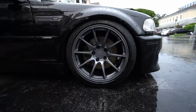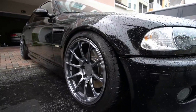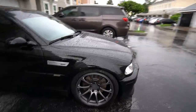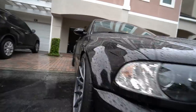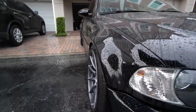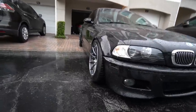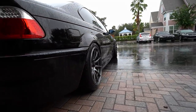Looking at the front, it's a pretty tight fit up here as well but there was more camber that needed to be adjusted. Up front I believe we're sitting at negative 3.5 degrees, which is pretty good for handling — a lot of people who take their E46 M3 to the track run negative 4 to negative 4.5. But this is more of a daily than a pure track car, so I'm looking to maybe straighten the wheels a little bit in the front if there won't be interference at the top. As you can see it's a very tight squeeze, and you want a little clearance so when you're making turns you don't eat up your entire fender. There's slightly more camber in the front — like an extra negative degree — definitely not what I want long term; I want to go to at least negative 2 or 2.5.